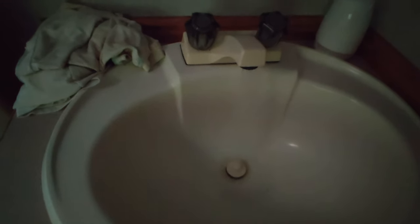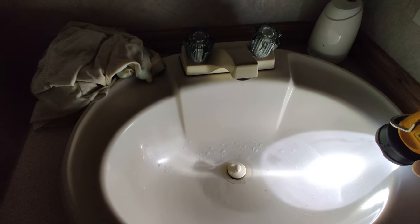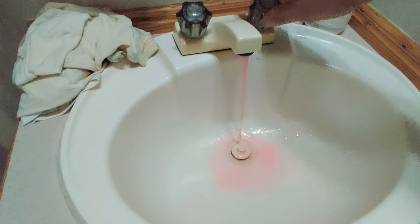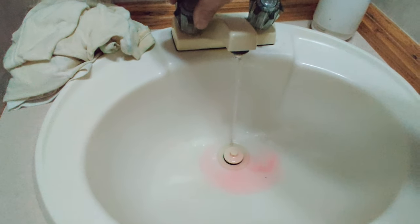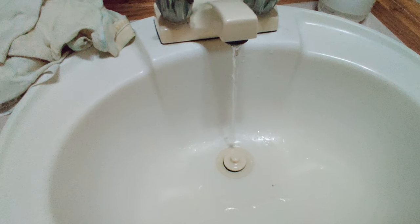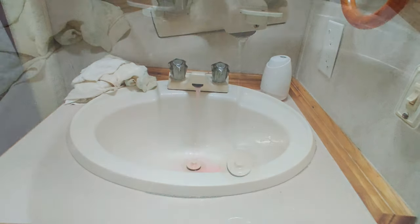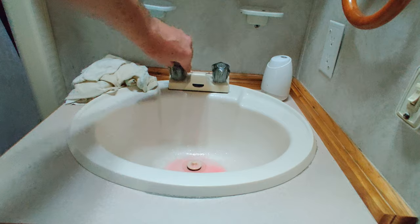We're inside the camper. We're going to turn on the water pump, which will start pumping the antifreeze into the system. Open a valve — you can see there's water coming out, and as soon as it starts turning pink we know that line's good. Now it's pink, so we shut that valve off and do the same with the next valve. Periodically you'll need to run out and check the level of antifreeze in your bottle.